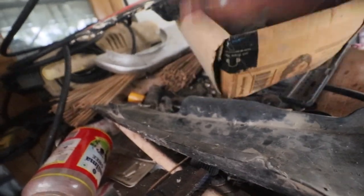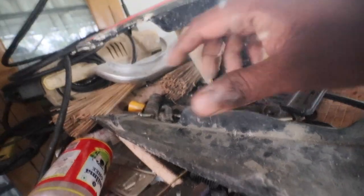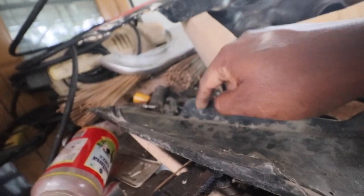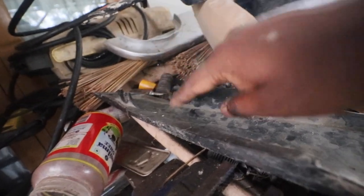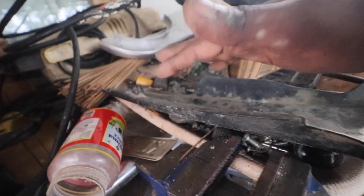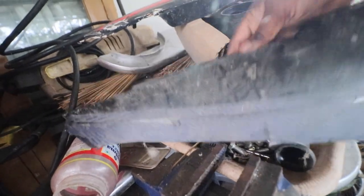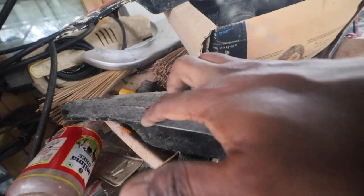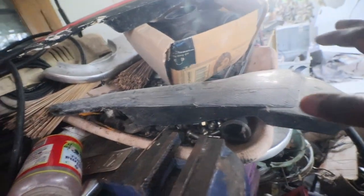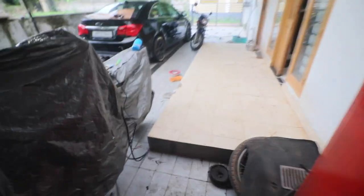The plan is to cut the good section from one panel and graft it onto the other. I'll cut from here and stitch it using a soldering iron, then put a muslin cloth over it and apply Araldite so it's properly plastic welded. We'll do a similar exercise on the other side, sand the whole thing, and it will look as good as new. But I don't think that's going to happen in this video.